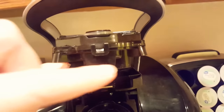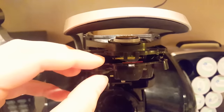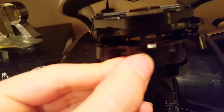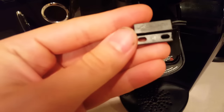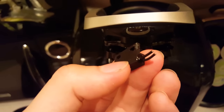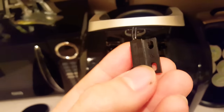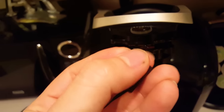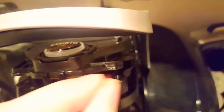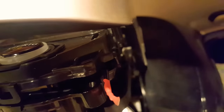That'll give you access to where the magnet sensor is located. Basically what you're going to be left with after you get those clips undone all the way down the sides and the front is you're going to be looking for a little sensor that's placed directly in this lower area of the front. It's a little sensor. The top of it will look like this, and it should look something like this from the top. You pry that up and out. Basically what this sensor does is when it senses the appropriate magnet it will close and loop those wires together. So to bypass this sensor, you cut those two wires off as seen here and just splice them together.